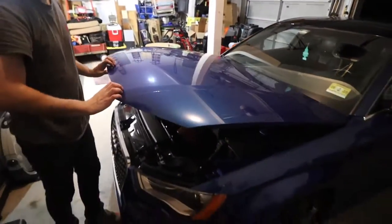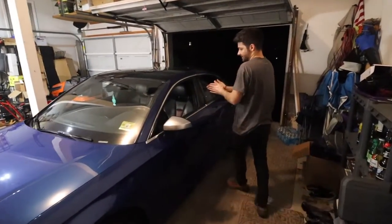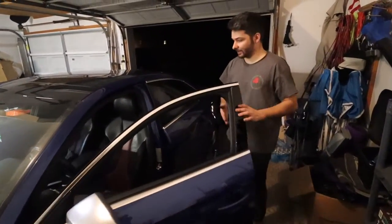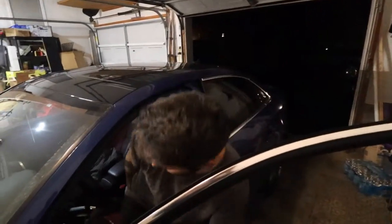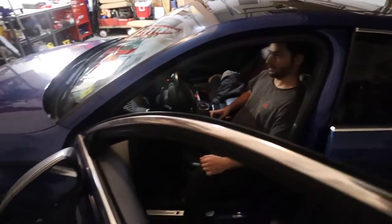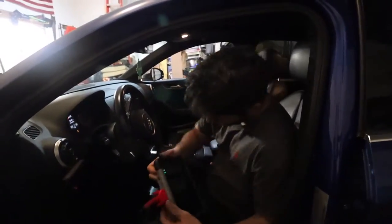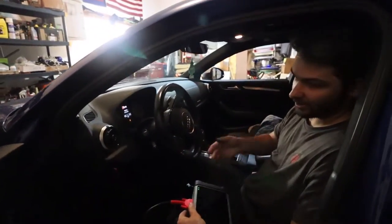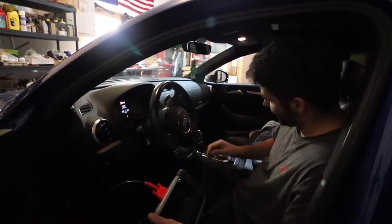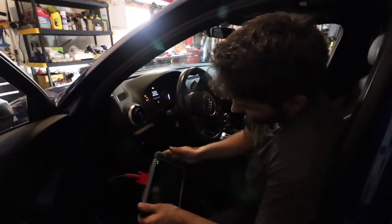We can close this, pump up the brake to get some pressure in it and push those pistons to touch the brake pad and create a clamping force, and then we'll just have to reset that parking brake. So, let me just pump up the brake. Once you feel your pedal get firm, that they're touching. Of course, once you turn the car on as well, you'll probably have to re-pump them. But now let's turn on the e-brake so we won't have any issues or any sensors.